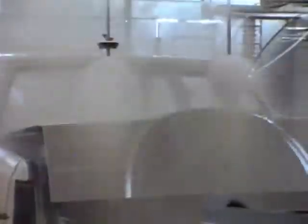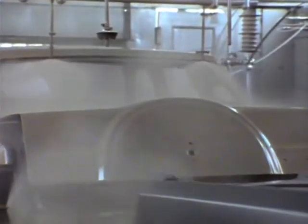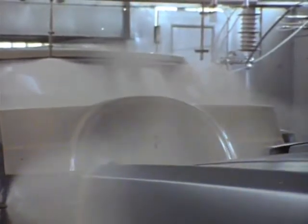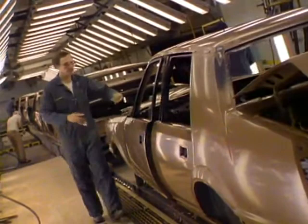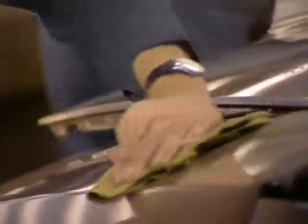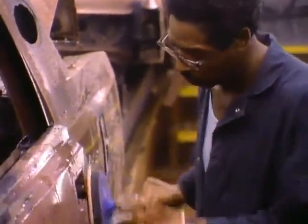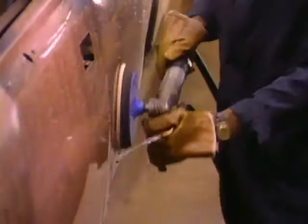After the e-coating is completely air-dried, the body is sprayed with an even coat of primer on an automatic prime spray line and thoroughly dried again in special production drying ovens. From there, the bodies go to a prime coat inspection area where they are thoroughly checked for any defects of any kind that would affect the final finish of the car. If any defects are found, such as rough spots or sags, they are fixed right there before that body can be released for finished painting.